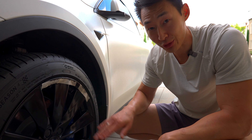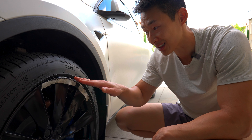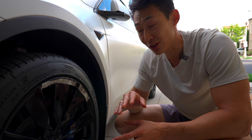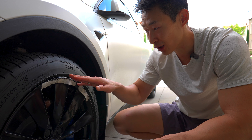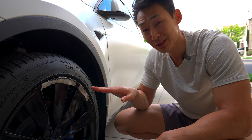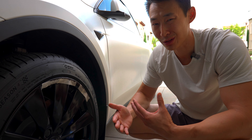Let this dry and keep doing multiple coats. I just did the second coat, so we're going to do another coat because I could still see the metal and it's still exposed. What I recommend is make it very uniform — don't do a patch here and then a patch there. If the curb rash is close together with a tiny gap, just sand it all down so you have a uniform paint job in that whole section so it looks a little bit better.